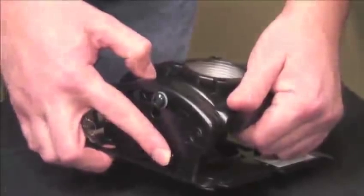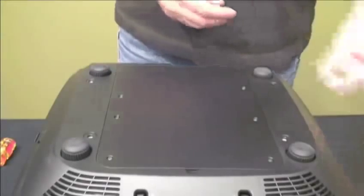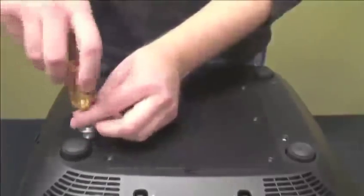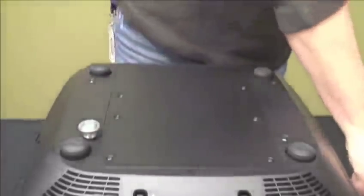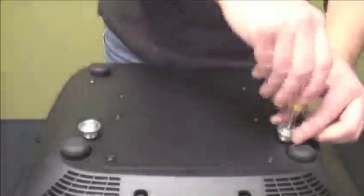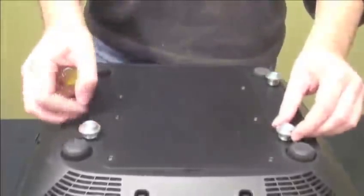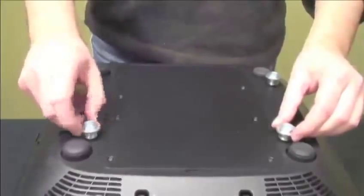The RPA Elite also features industry-first micro adjustments and an integrated lock and key system, along with a lever for increased security. The first step in the installation is to attach the four mounting buttons to the projector mounting inserts with the included hardware. The buttons are easy to install with a standard screwdriver and fit in the existing holes in your projector. Make sure to install each mounting button in the proper hole and tighten to secure. You can turn the height adjustment nut to the correct height for your projector, making installation faster and easier.